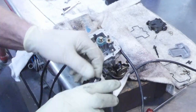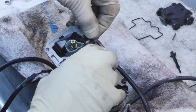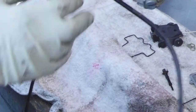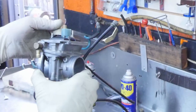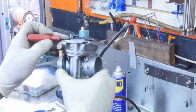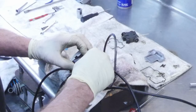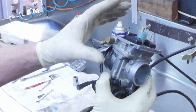We've got the needle and seat in, we've got the spigot for the fuel — we'll put the jets in. Always double-check your jets. I'm putting a brand new pilot jet — it had a 45, I'm going to put a 45. We're going to tune this bike on part two and show you about the jets. You want to keep the jet in there that was in there most likely. The long hole gets the long jet, the short hole gets the short. They don't need to be super gnarly tight, just snug. The main jet can go in. Now you can put the float on and test the float — so that's what we're going to do. Install your needle and set it in there, put your pin. If you didn't mess with the float it shouldn't be off. You basically want the float when it touches — this one's a little low — it'd be better if it was right there, with just a little bit of closure angle to it. So I'm going to change it a little bit, pushing the tab down.